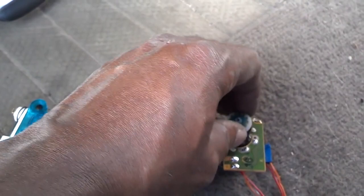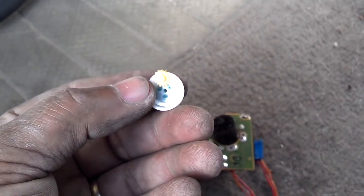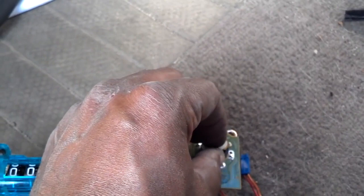Once you get this motor assembly off the side, you see that little gear pack there — lift that up off the motor. You don't want the motor to come out; leave that in there. On the back, you see that little plastic piece with teeth on it — that's the gear that's normally broken. It just slides off that plastic piece and slides back on, then you slide this back on the motor and start putting everything back together.